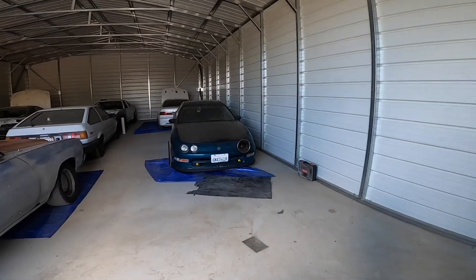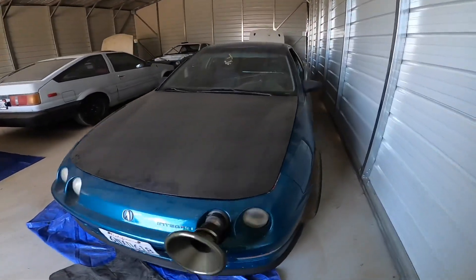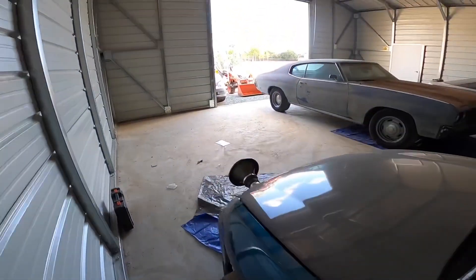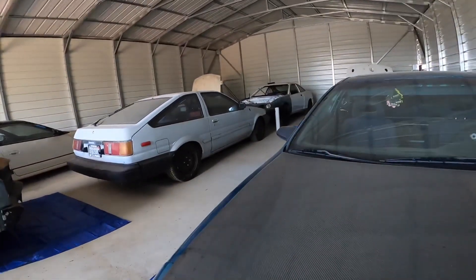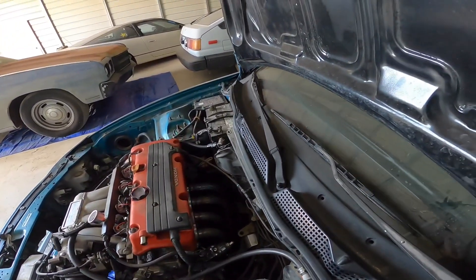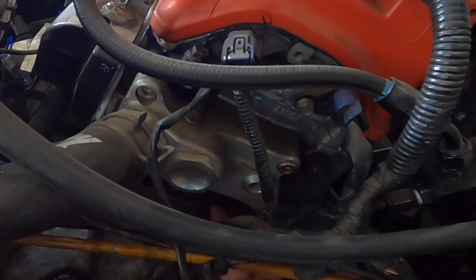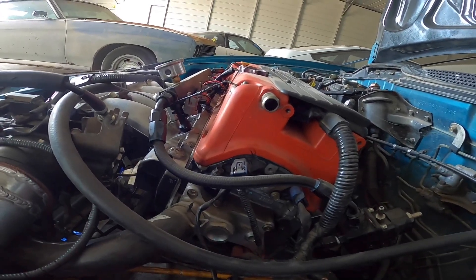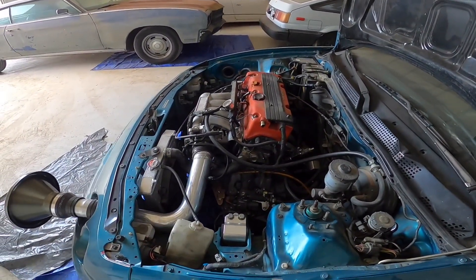We don't have any electricity yet but since we parked here I'm going to go ahead and check it — it's got a coolant leak. Let's go ahead and pop the hood open. This shop actually came in clutch, we were able to park all the cars. You can see coolant pooling right there. I got a feeling it's probably coming out from this thing right here — yeah, seemed like it is. So we might just get a gasket for it. Let me go get the pressure checker and then pressure check it.